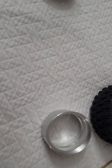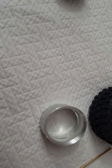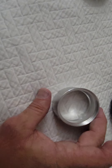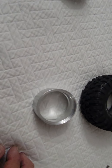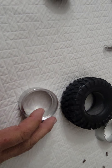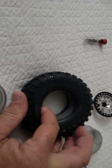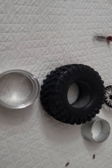If you go with 2.2 foams because you think this is a 2.2 rim and you need a 2.2 foam - that's not correct. The foam is going to make this too big; once you have the tire on there it's going to spread it out beyond its original diameter and then you'll have rub issues. Take your 2.2 core rim, squeeze it on the inside - this inner foam will expand enough to go around there.